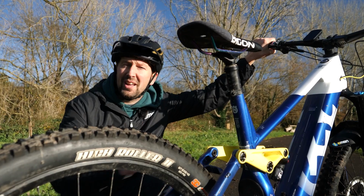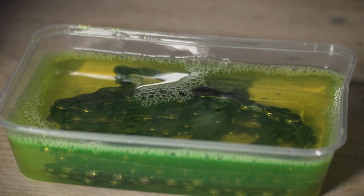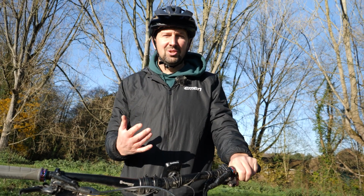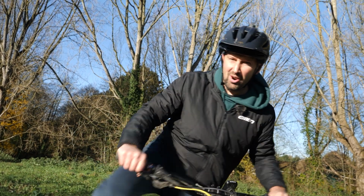And degreaser, well, that's great stuff, and as the name suggests, it will take the grease out of absolutely anything. So just go careful if you're working around your motor or your wheels with degreaser. And one last thing, if your brakes are noisy, don't go applying lube or grease to them. All you're going to do is totally ruin your brakes and make that noise even worse.